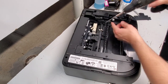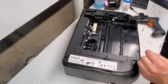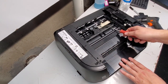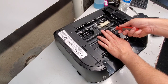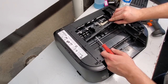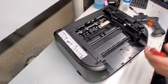To remove the paper pickup roller, we're going to remove this screw. This is just a quick video — I have a similar model that I just posted a video of and it's very similar. The paper pickup roller is right here. We need to remove that piece and just lift it with a flathead screwdriver very gently. Start with this side, pick it up there, and now pop it out. Be very careful, kind of push it back — and it's out. If your gears are broken in here, you may want to replace this piece; sometimes they're available online.